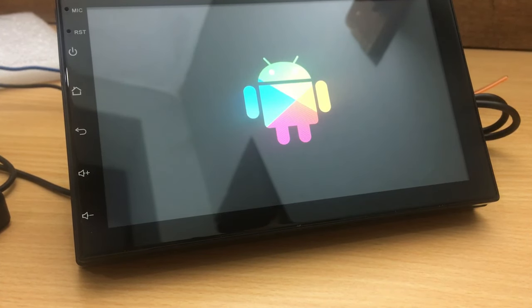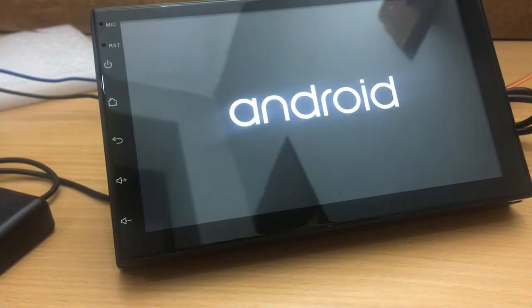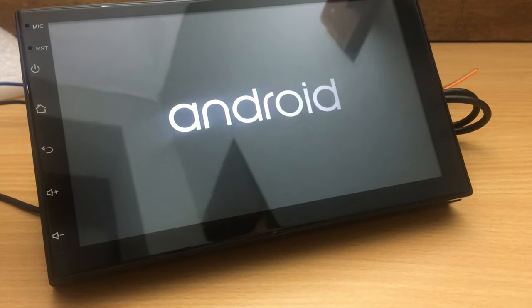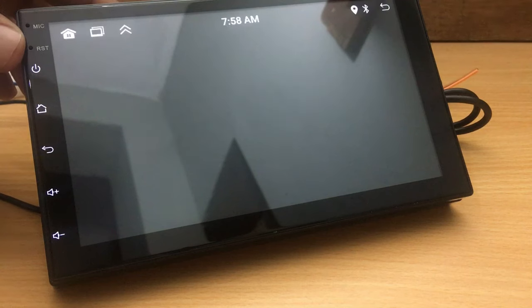Since it is the first time, the device will take a considerable time to boot up. When the device is installed in the car, as the power comes continuously with the yellow wire, the boot time will not be longer than this. However, if you give the power from an external power unit, give at least 2 amperes. Else, the device will not work properly.